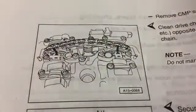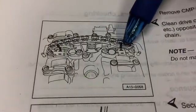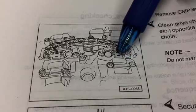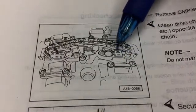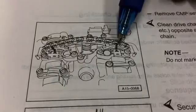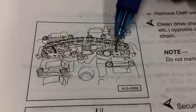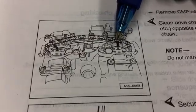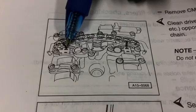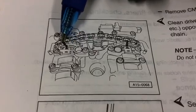Looking in the book, on the intake side you can see the arrow and the notch, and there's a mark right there — that's your half link, so that's your start. The intake is straight up and down, so you go 16 over and you can see the arrow and notch, and it's a bit off to the left.